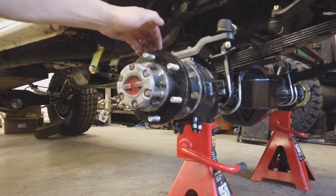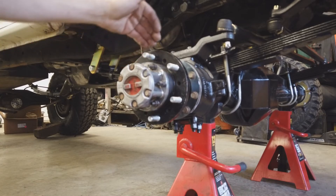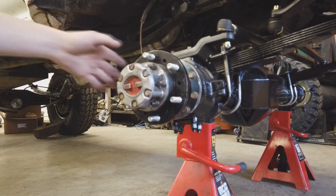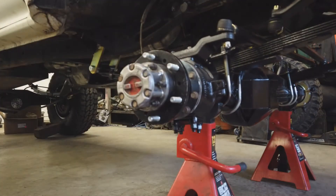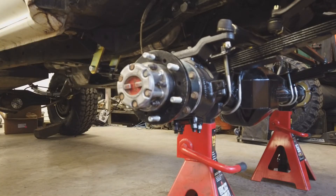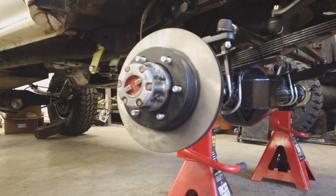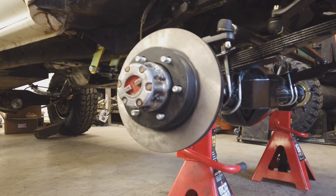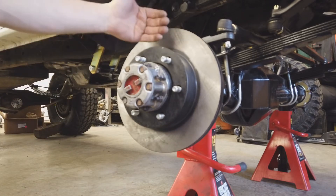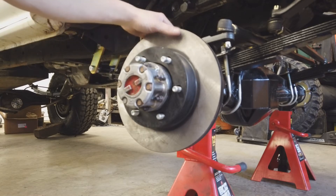Here is the hub — this is an IFS hub. Basically anything from 86 and up, second-gen 4Runner, third-gen pickups — they are differently spaced. How it works is you're going to mill down the outer diameter to fit the inner diameter of your rotor. Now I can actually take this rotor and it slides right on, so this rotor is basically a full-float system. With the factory setup it would bolt to the back of the hub, but you'd have to press the studs through and it's kind of a pain, so this is just a lot easier.